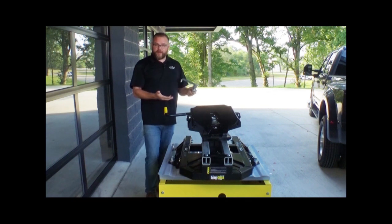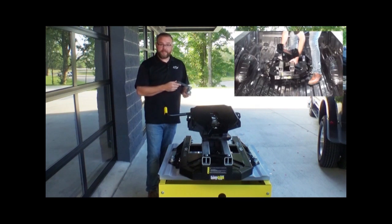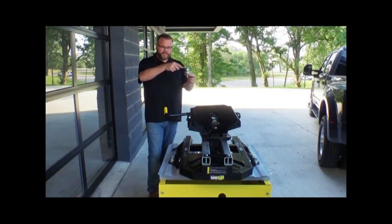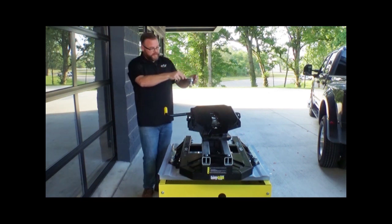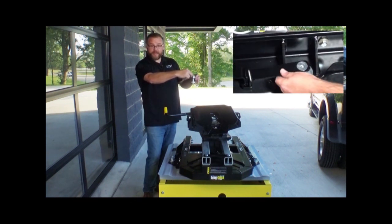When we're putting this fifth wheel hitch in the bed of the truck, the base is about 150 pounds, so it does require lifting it and setting it into the bed of the truck — and that's the case really with all fifth wheel hitches. Now with our OE series, because we pull the post out of the hitch, the hitch is really quite smooth across the bottom, so we can easily lift it into position and position it right over the top of those factory pucks. Once the hitch is in position over those factory pucks, we can easily drop this post down through the hitch and lock it into position. This nut here has a very fine tooth adjustment — every sixth of a turn we can lock that into position.